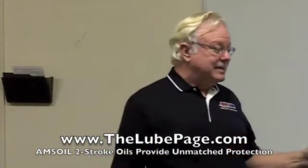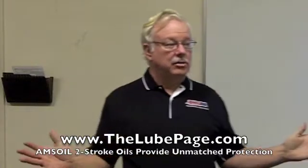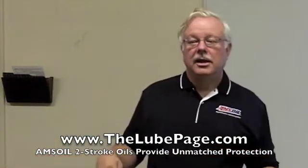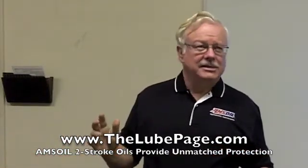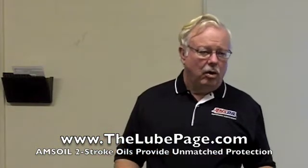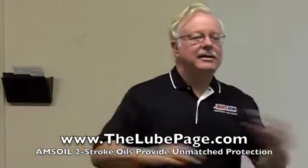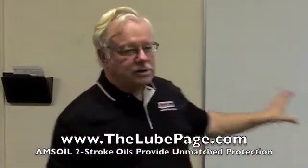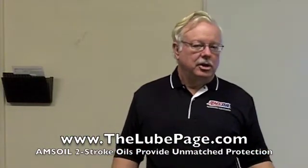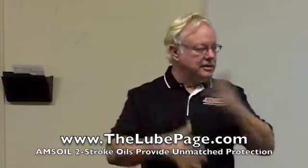Now, AMSOIL has a test they ran, and they'll produce it when they finish and dot all the I's and cross all the T's on a comparison using the XD100, I think it is, the Evinrude E-Tech oil from the factory versus the AMSOIL HP injector oil. And without getting into the details or trying to get down under their report, just let me tell you this, you cannot tell the difference. That's what it comes down to. You cannot tell the difference in which oil was used in which engine when you do all of the certifying tests, when you have these engine testers and guys that tear it down.